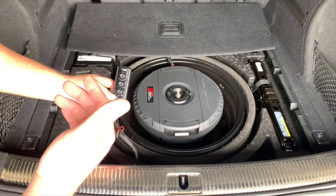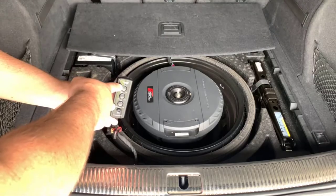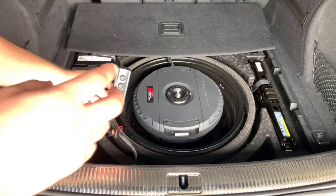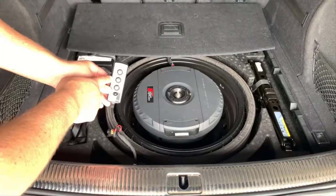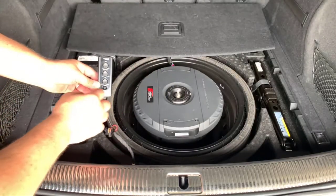I have it pushed in for 180 degrees, so I actually phase it. I also have a low-pass filter set at the middle. I set the gain to about mid-high, and then the bass boost is a little bit higher. The gain will take the existing signal and boost it up. The bass boost — when you turn up that dial — is going to take that signal and boost it above and beyond whatever it's receiving from the line input.